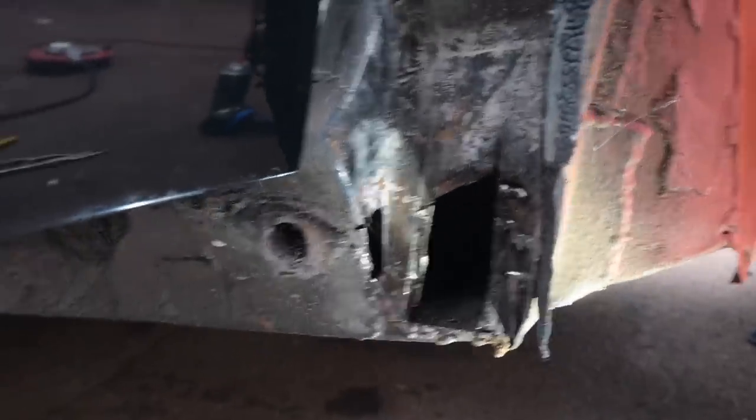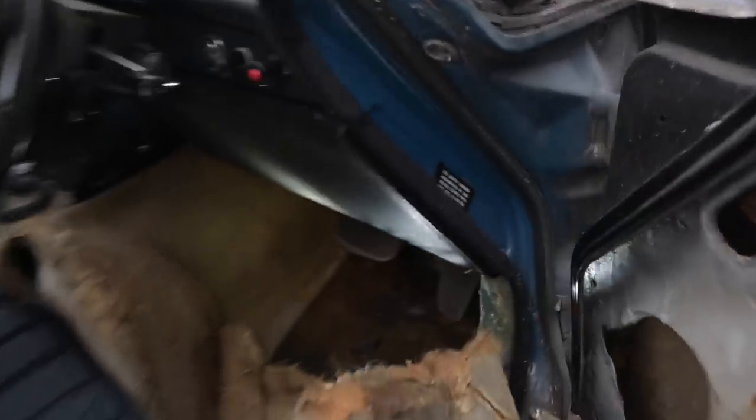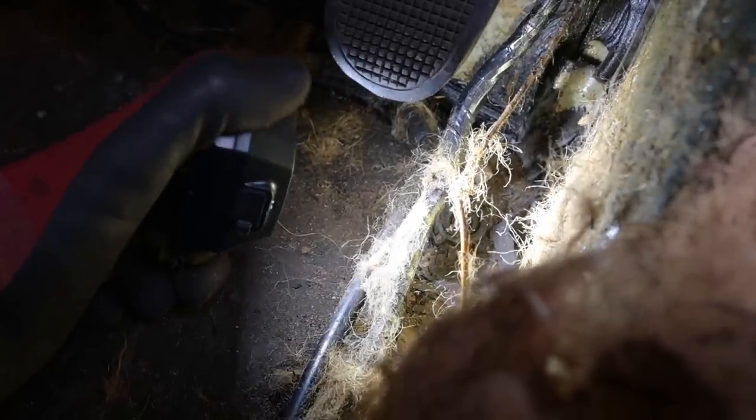This has been one of those escalating situations which I did not want to escalate today. This is not what I wanted to be doing. So I've cut this nice old triangular weird shape underneath here, which is going to take a bit of filling. However, I can see daylight through there — I push my finger in and I can feel squishiness. The only place you're going to find squishiness in this area is the back of this carpet, because I've got a blooming great hole in the floor, which means I've got a bigger job on my hands than I anticipated. So I need to be cleaning up a whole bunch of this horrible stuff, back enough to clean that bit of hole. I've cleaned up around this area so there's not too much stuff to catch fire. I made a weird bit of shaped metal to fill that hole up, and hopefully we've now got no hole in the floor.